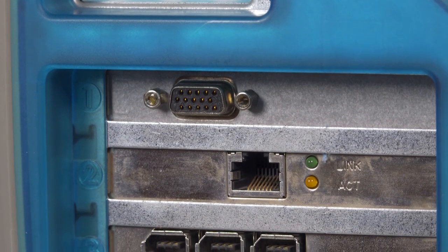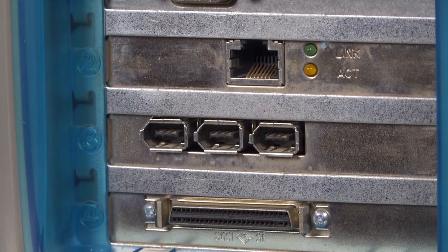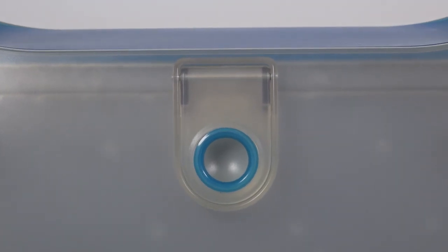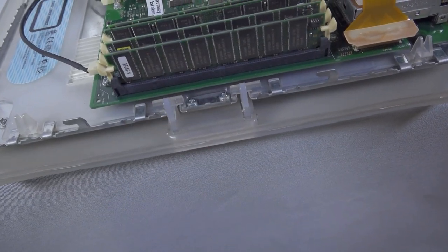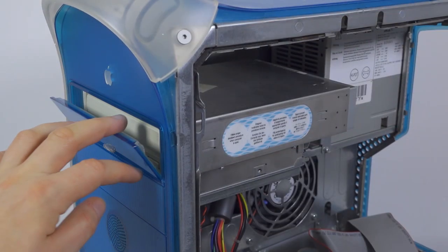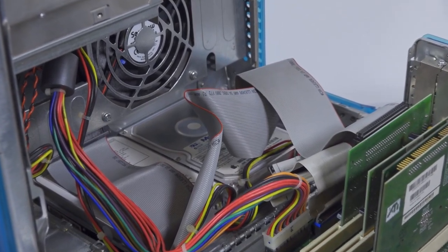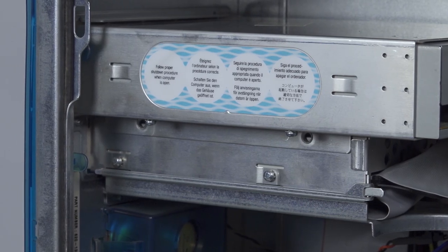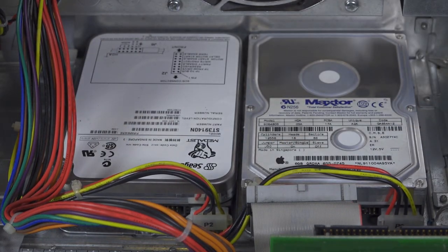This particular machine also wields another Ethernet card, a FireWire card — apparently due to the onboard FireWire having broken — and a SCSI controller. The big lever on the side is how one gets inside the machine; pull on it and gently lower the full panel. Within are four RAM slots, currently configured with 704MB of PC100 SDRAM, a 32-speed CD drive, and a 6GB hard disk hooked up to the computer's high-speed Ultra ATA bus. The CD drive and optional Zip drive had to make do with a slower one. Next to that is a dead SCSI hard disk, which is pointless — I have a replacement somewhere but couldn't find it in time.